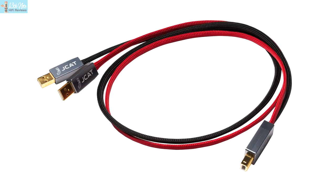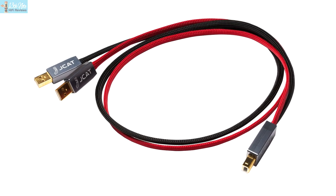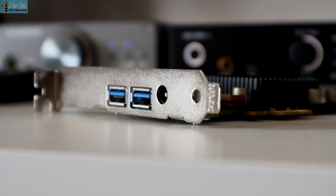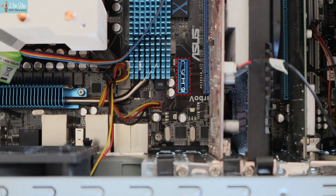You've got the option to use both outputs for two DACs simultaneously, or you could use one of the USB slots as an input from a music pen drive and then just use the other as an output to your DAC normally. Alternatively, another option is to use a dual USB cable — one carries the data signal and one carries power. You'll notice on the external slot of this card that it has a barrel input, which is a power supply input to use instead of your PC's power supply. It uses what is called a PCIe connection, which is basically the slots on your motherboard that you plug it into.